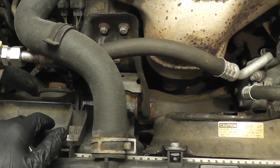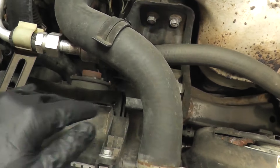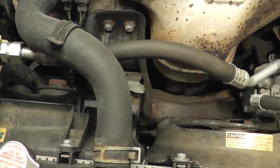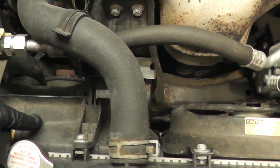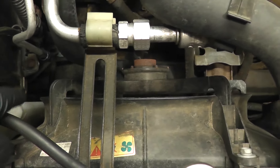What's most likely wrong here is the bearing in one of these fans is bad. The easiest way to test them is just spin the blades, but before you do that, a word of warning: some vehicles can turn on the fans even while the key is off. So you want to either disconnect the negative battery terminal, disconnect the connector to the fan you're testing, or go to the fuse box and pull the fuse or relay for that fan.